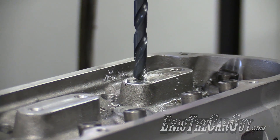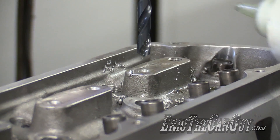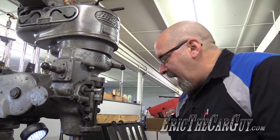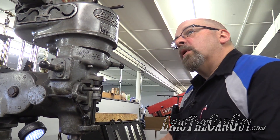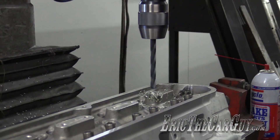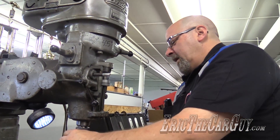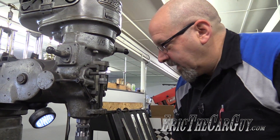I'm looking for any drill bit deflection — it has a factory chamfer. I noticed you didn't put another chamfer on the top. Is it necessary? I can come back with a drill and go right down the line and chamfer the tops. It keeps the threads from pulling out and relieves the burr off the top. If we had a CNC machine that'd be really slick — you'd just program it in, push the button with all the different tools and chucks, go grab a cup of coffee, come back and change the tool. Hit cycle start and get a coffee.